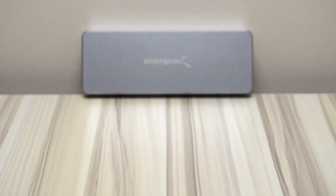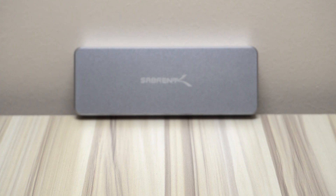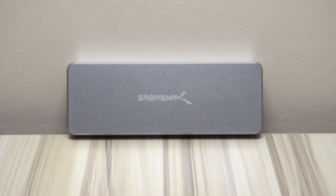The second option is the Sabrent USB-C 3.2 Gen 2 enclosure. While the Samsung is more of an all-in-one plug and play solution, this is more of a DIY option — you need to supply an NVMe drive. I've got the Sabrent Rocket inside, which I had left over from my Hackintosh. One disappointment is that it comes with a USB 3.2 Gen 1 cable, which limits your speeds. Even so, I was getting about 603MB/s read and 589MB/s write. The Gen 1 cable is half the speed — 5Gbps versus 10Gbps — which is a bit annoying and does hamper performance somewhat.